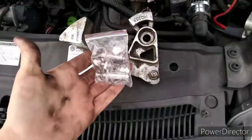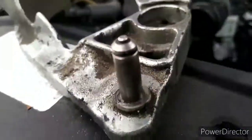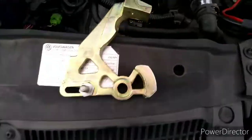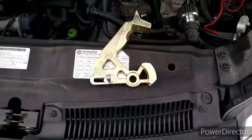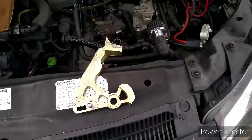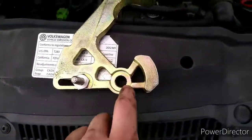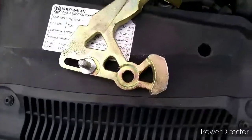The reason there are so many connectors is to match up which one yours has — mine would be that one right there. I've got mine set at the lowest throw time; I think it decreases your shift throw by 40%. Now when reinstalling this you're going to want to lube up everything — this and this right here is what I would recommend.